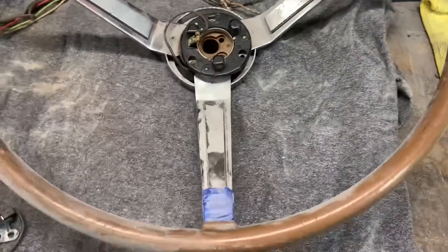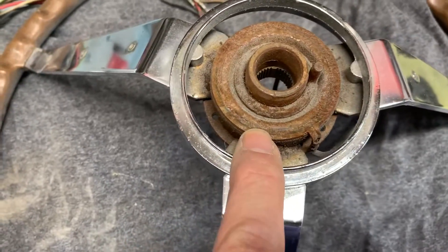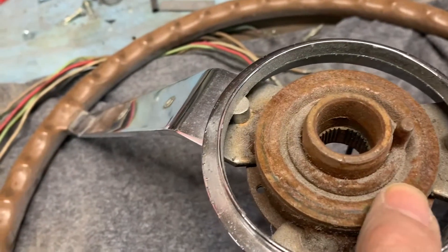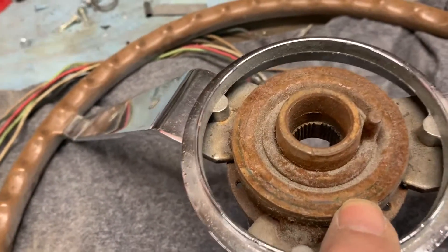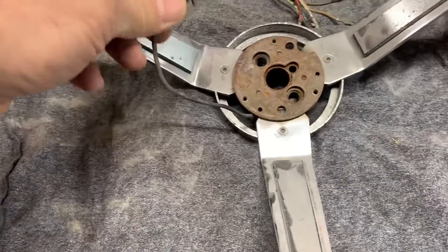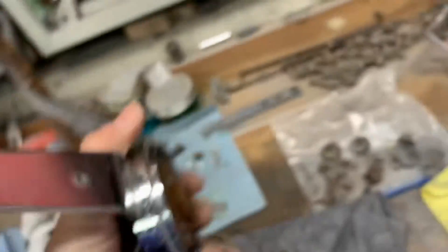What if it's worse than that? What if we've done all that and it still doesn't work? Another common failure point is on the back side of your steering wheel where this is supposed to ride — if that's corroded, you're not making contact. That signal to ground to the relay is not getting there; this needs to be cleaned. To do that, the steering wheel does need to come off. So if you're putting on a new steering wheel and you've got it off, clean that up before you put it on. The wire perhaps is corroded or frayed and maybe not attached very well — those are things to check.